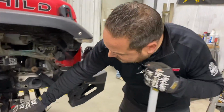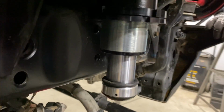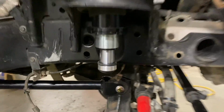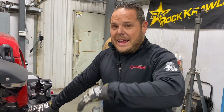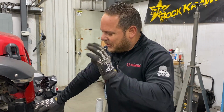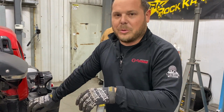Oh, we're finally going to air bumps up front. Show them this. Air bumps! Radflow, super awesome, sent us some customized air bumps per rock crawler specification. I don't know if I want to tell you what the secret sauce in that is. Maybe we'll go over it, maybe we won't. But we've been waiting for air bumps for a long time. We kind of treat this thing really badly off-road, and Kevin has a Hemi and likes to hit bumps and jumps and whoops way faster than he should. The rubber ones weren't keeping up anymore, so it was time for some big boy air bumps.